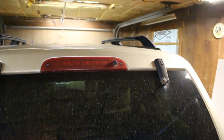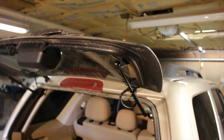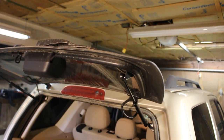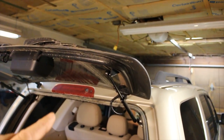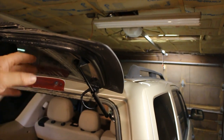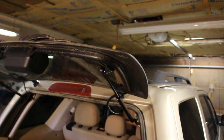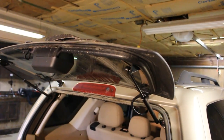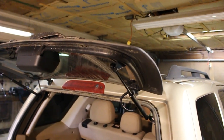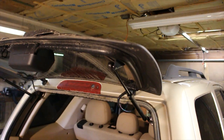For this job, all you really need to do is open the hatch — you don't need to open the whole back and you won't need to unplug the defroster wires because you're only going to be doing one side at a time. But once you release and pop these off the pistons, the hatch is going to want to drop, so be ready for that. One support will not hold it up — that's why they put two on there, but one just ain't enough.